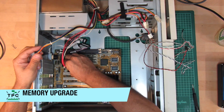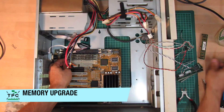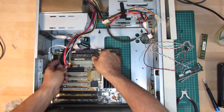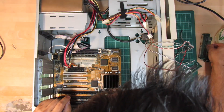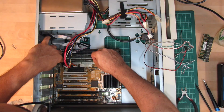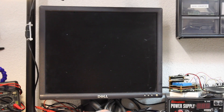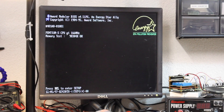Back to the mainboard, where I was swapping in a new coin cell. After mounting the replacement mainboard back into the chassis, I'm pulling some of the memory modules. I have some higher capacity ones left over, so I may be able to bump it up a bit. Now I have 96 MB of RAM — as I'll be going with Windows 98 Second Edition, that's plenty.